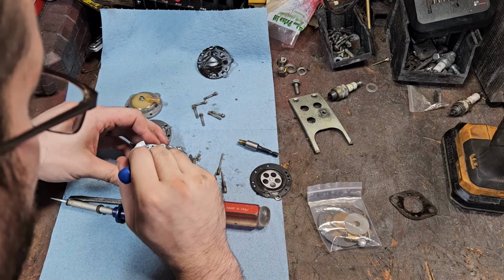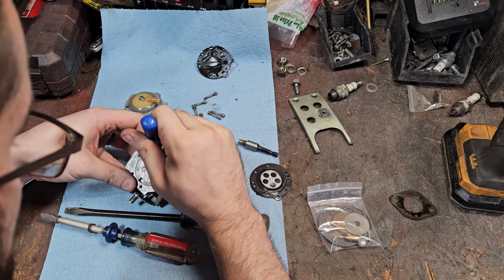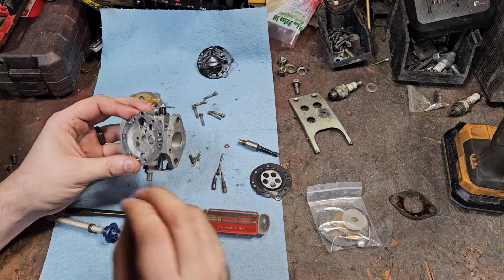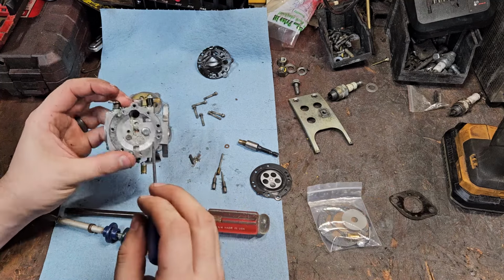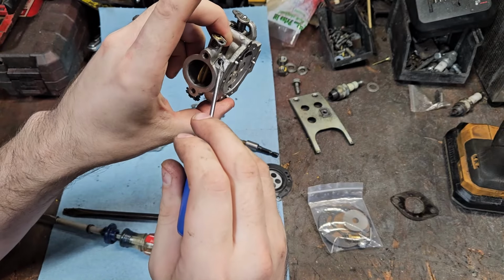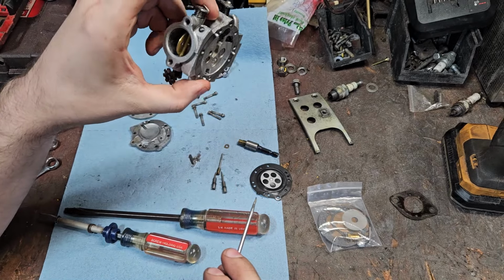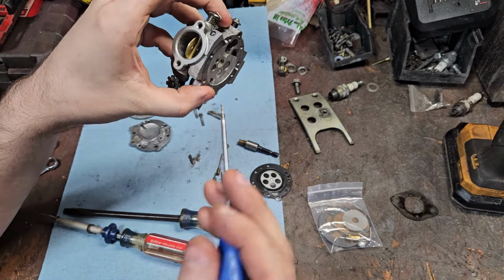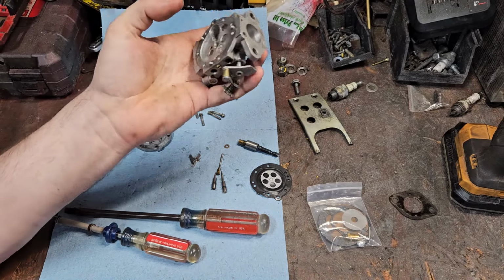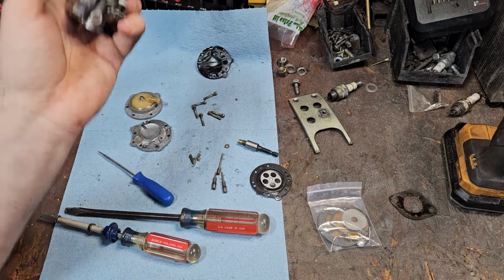And then there's a copper washer down in there for sealing, or brass or whatever they decided to use that day. There it is. Don't forget about that. Other than that, it's pretty legitimate. Oh, see? There's another jet setting they crammed in there, all the way in. That was another way to feed jetting, for highs and lows. Kind of universal on their carburetors for who they were making. But that is ready for the ultrasonic cleaner. All rubber bits and stuff are out. Put her in there, let her cook.